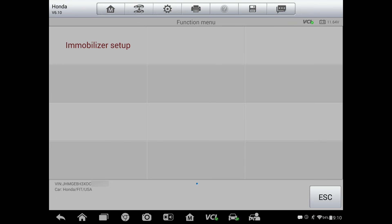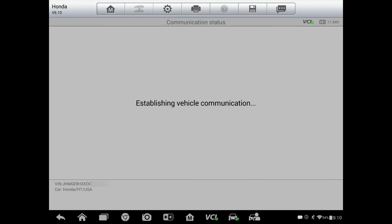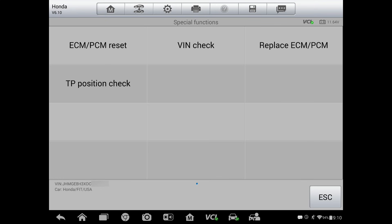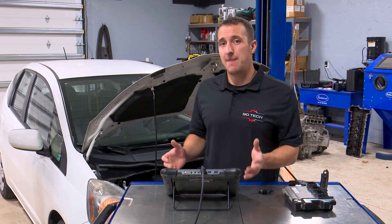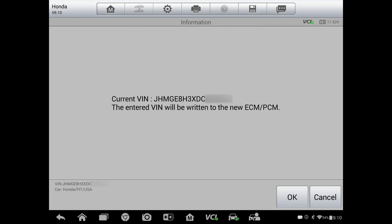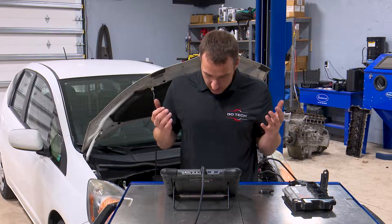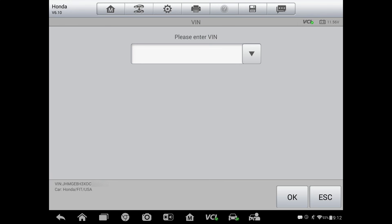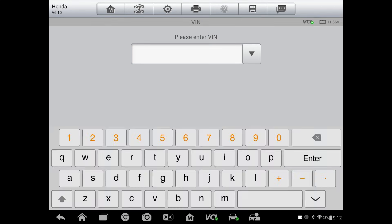Now we've got to go back to the engine PGM-FI, and that's where we're going to write the VIN. We'll go to special functions and go to VIN check. There is a PCM-ECM replacement option, but that's more for grabbing data off the old ECM to put onto the new ECM — we're not going to use that. We're just going to go to VIN check. So this is the current VIN, and this is the incorrect VIN of the vehicle. This is the correct VIN. It looks like it had the correct VIN, but we'll manually enter it — it must have pulled the current VIN from a different module in the car.